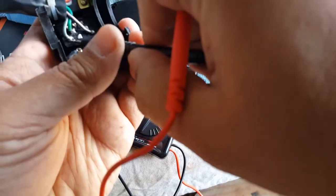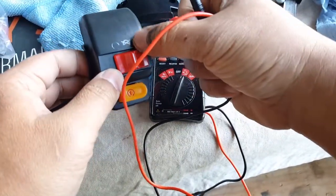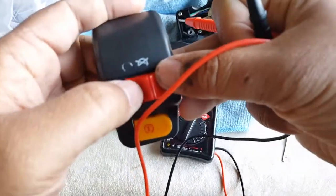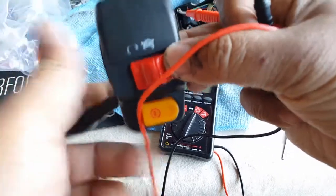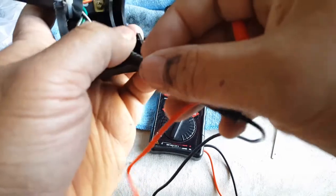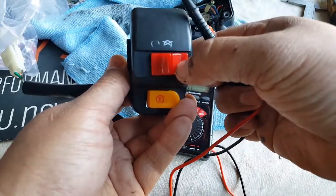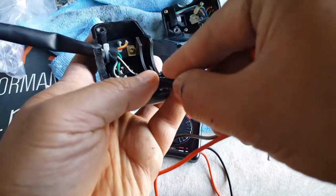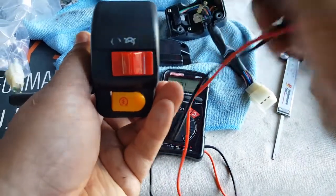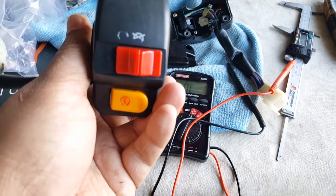When we turn on the kill switch it grounds the switch which allows it to function. Let's see — right now the kill switch is on kill, meaning the switch is off. I mean, it's kind of hard to explain — let's say the scooter will not turn on because the kill switch is effectively enabled. When it's right here open, that means the kill switch is disabled. So when it's actually turned on like this is why your scooter works. The reason why mine probably didn't work with the auto start is probably because that fourth prong is missing — that fourth prong was probably controlling the independent switching.